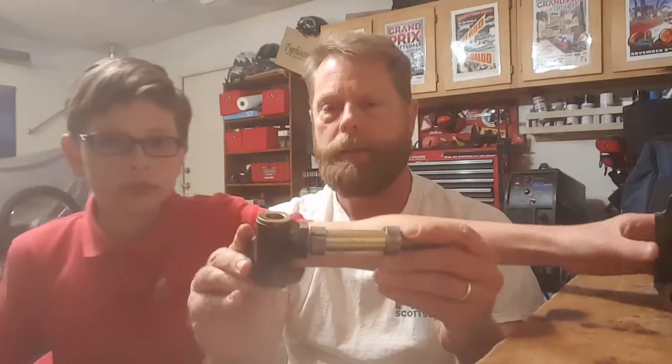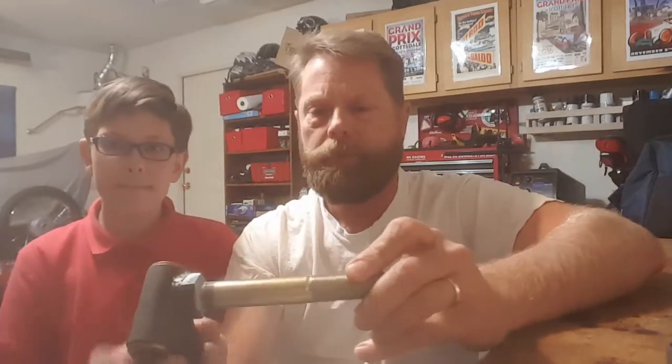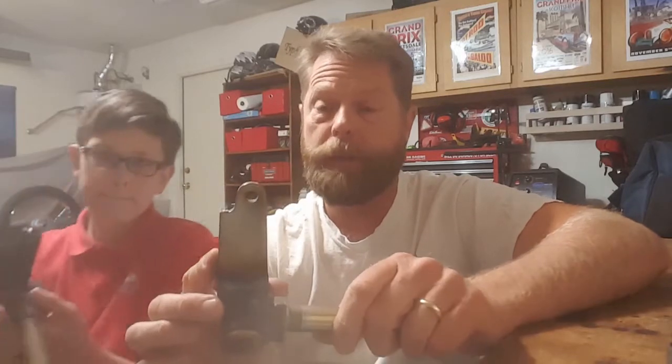We're going to replace them with these parts made by Vintage Cart Co. This is a three-quarter inch grade 8 bolt with bushings — the proper size to accept the bushing. It replaces the Azusa spindle as a direct replacement, designed to look and fit exactly. If you have an Azusa spindle, this solves the wiggle in your front end because it uses bushings and a grade 8 bolt, making it super strong. It's designed as a retrofit — the Vintage Cart Co standard spindle uses a 5/8 bolt designed to fit their bearings, whereas this 3/4 inch version is made to fit Honda wheels or your own wheels with Azusa spindles, reusing your own bearings.